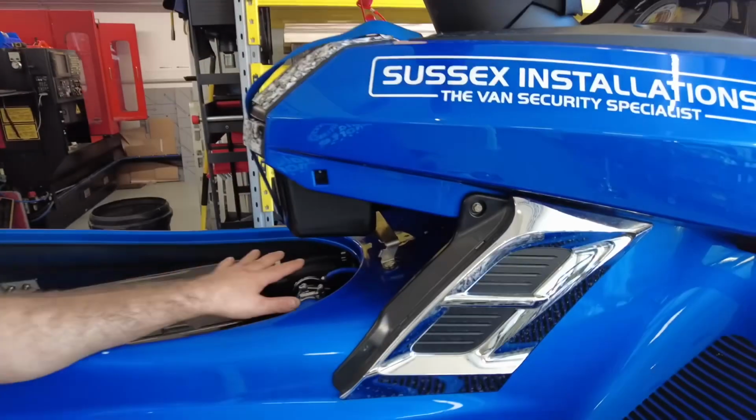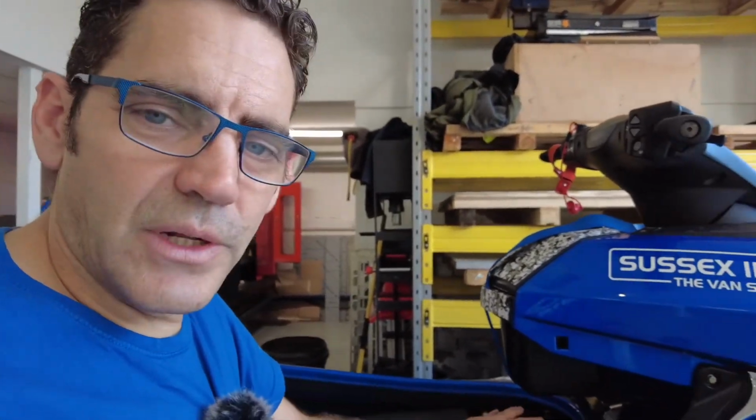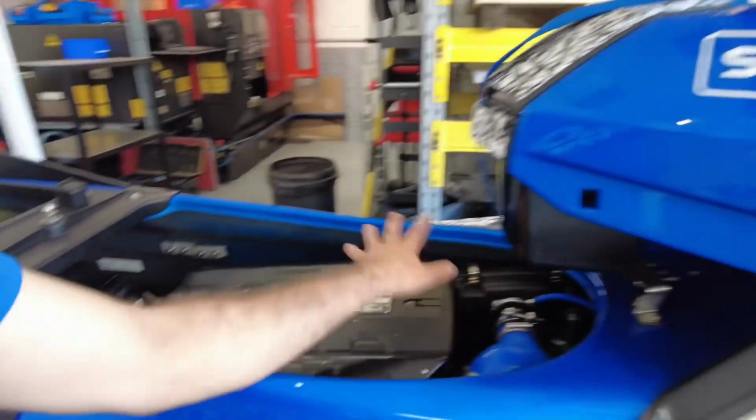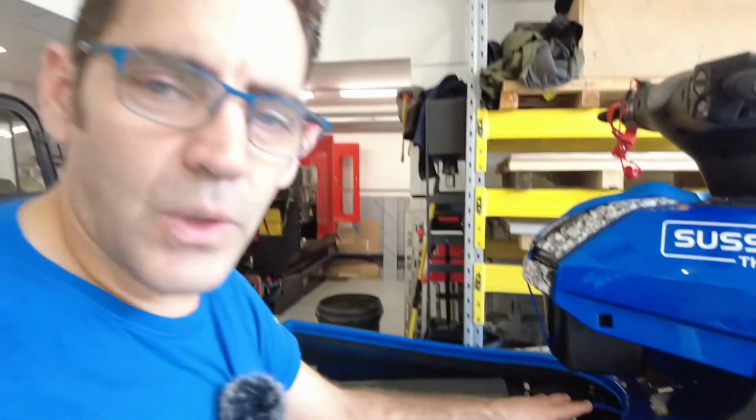We're also using these quite harshly. Like these skis at Nazare, the engines are ticking over. We're not stopping the engine because if a wave comes, that could be too dangerous. That's just an accident waiting to happen. So they will be ticking over, and the engine compartment will be getting moisture in it, especially on a hot day. Any moisture going around can mean there is a lot of humidity inside the hull. This whole compartment can be quite humid.